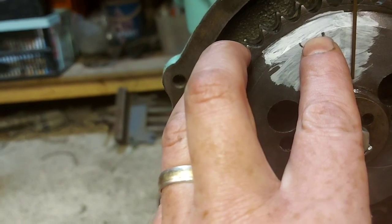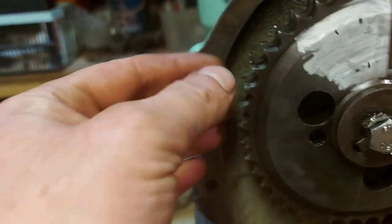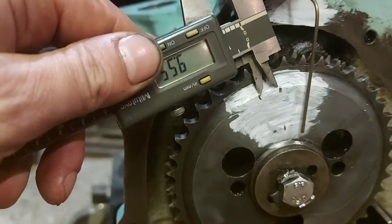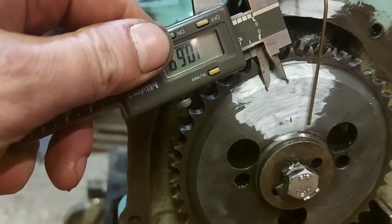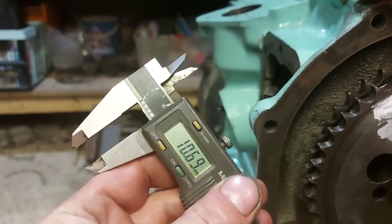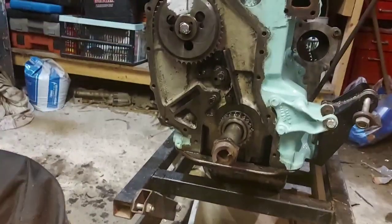That is where your exhaust needs to be open. So what you need to do is measure that. I'll measure it with this. I really am crap with this. Measure that there between them two spots, and that's 10.69 millimeters. Get you in view again. 10.69. Let's put you on there, you might be able to see a little bit better then.